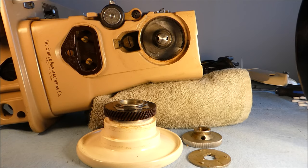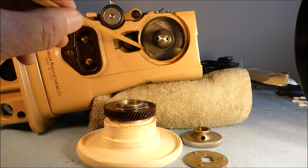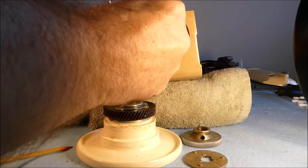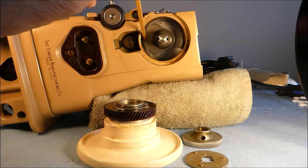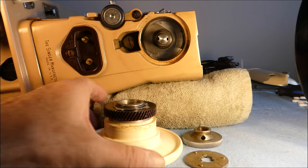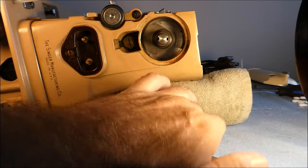Here at the work site we have the balance wheel, hand wheel, the washer, and the nut. I have a makeup pad here and I'll do a quick sweep in there to see how dry or loose that gunk is. It's fairly loose — some came off — but there's still a lot stuck and varnished on there. So we want to get the hand wheel on first, then the washer, then the nut.